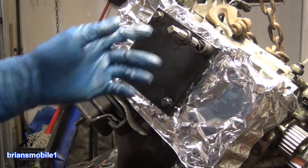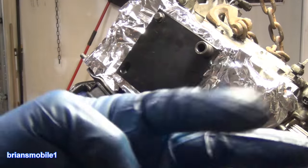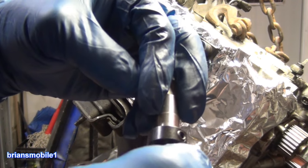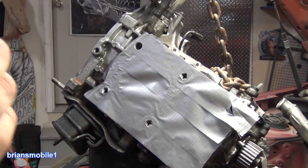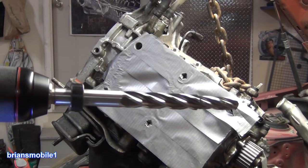If you do it with a drill, you gotta make sure that you get this chucked up right, because if you've got a three chuck drill like most of them are, how the drill bit goes in between the three, and this is four and it's being froggy, it's gonna mess with you and it'll be all wobbly and you won't get a good hole. We'll shoot for the stars and hit the moon. Hold things as tight and good as you can and you won't be sorry.